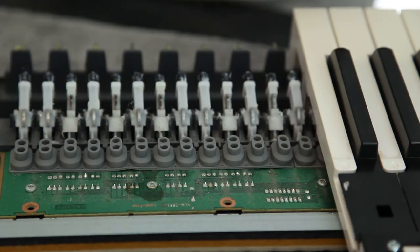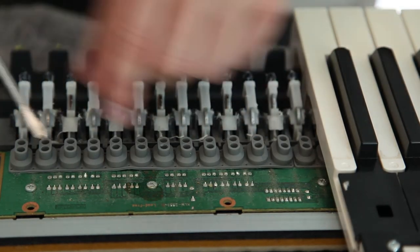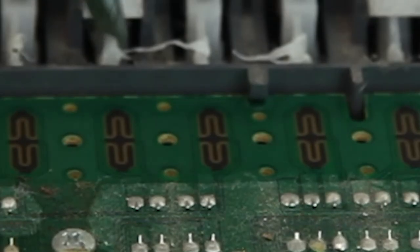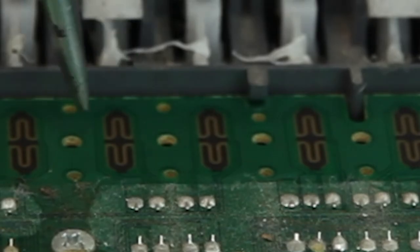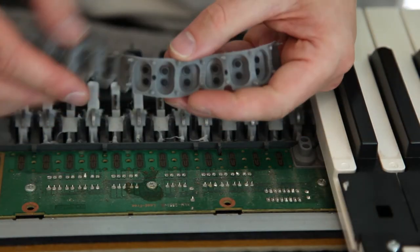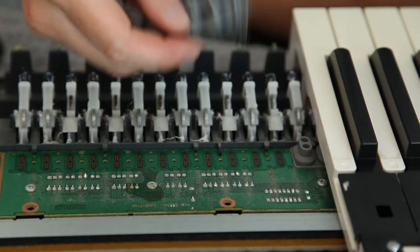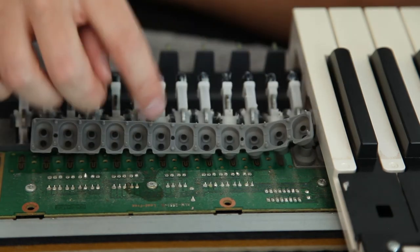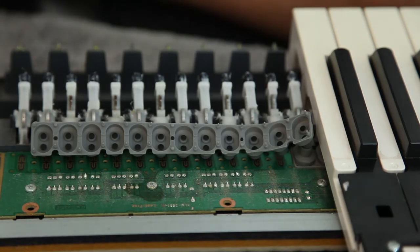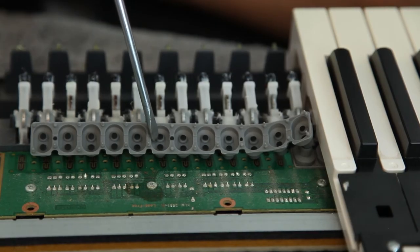Now often a lot of these videos say there's loads of dust getting in the way of the sensors. But you can see in this design the sensors are completely covered by this silicone sock. So I'm going to take the silicone off and we'll see we've got our carbon sensors — these are screen-printed carbon ink on top of the PCB in a U shape. We've got two sensors, one on top and one on the bottom. In the silicone pad there are two carbon pads. When I shorted these two with a piece of copper the key worked, which meant these pads were the problem. I got some isopropyl alcohol and tried to clean the pads with a cotton bud, but it actually made the problem worse — I ended up with problems across several keys. Cleaning the board didn't help either; all I was doing was taking more carbon off these silicone pads.